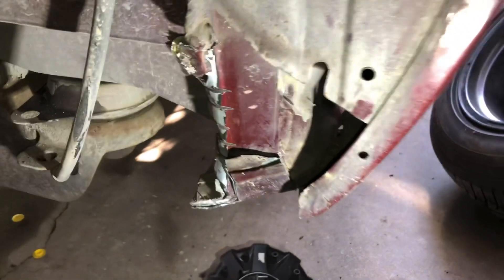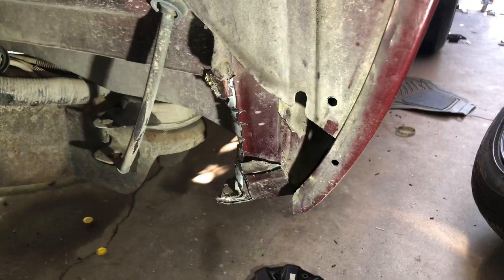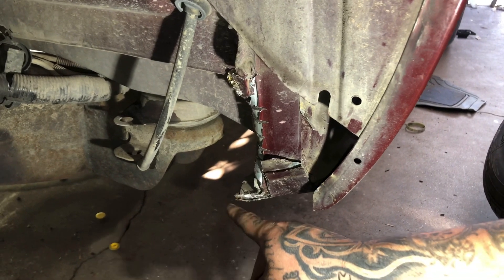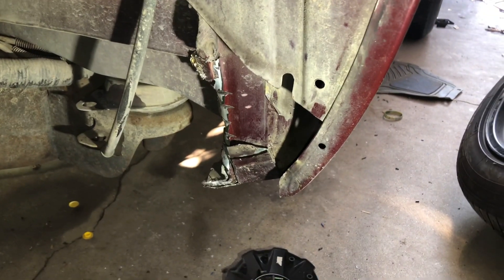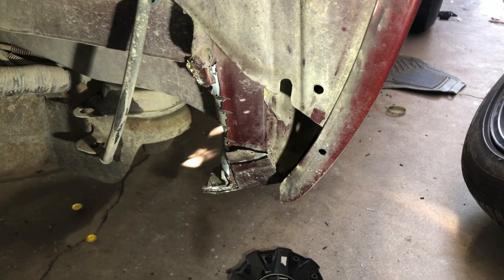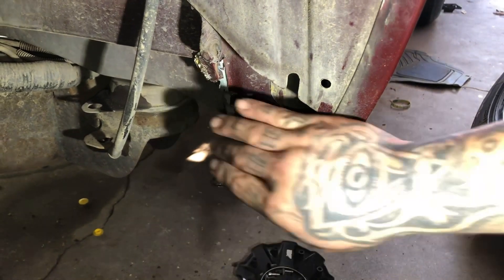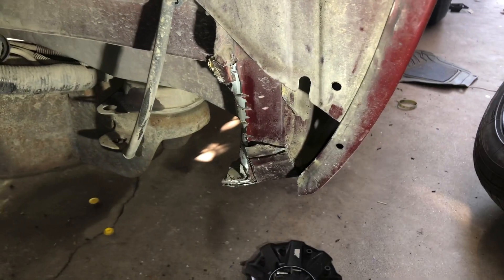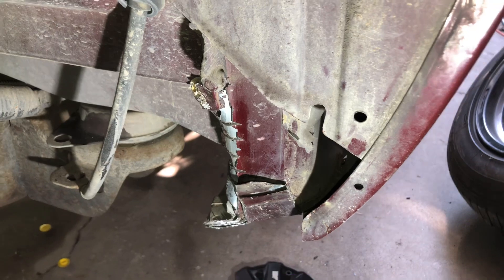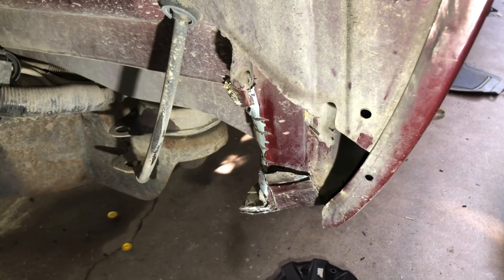You bend the tabs back and bend this up. I'm probably going to grind this little angle right there down a little bit, just because you never know — maybe the tire can get caught there and we don't want that. After you cut all this down you do want to prime it up and spray some paint on there so it won't rust, because now it's bare metal and exposed.